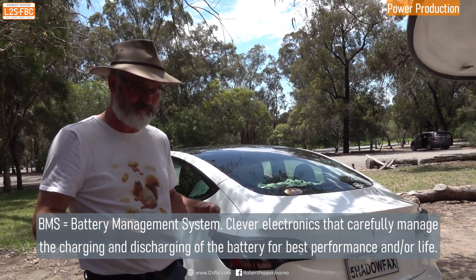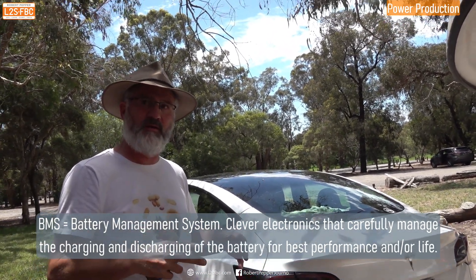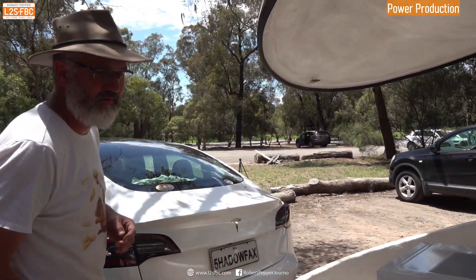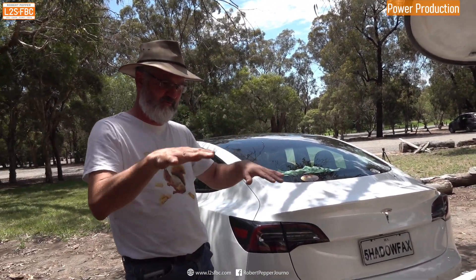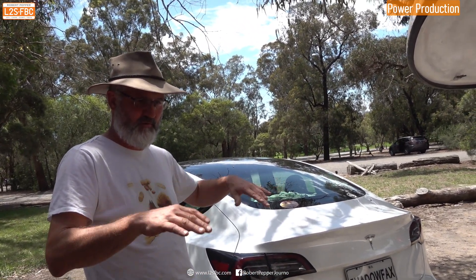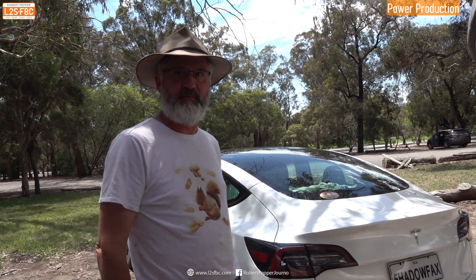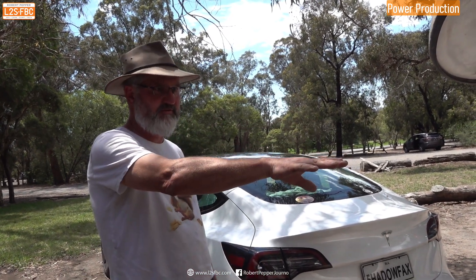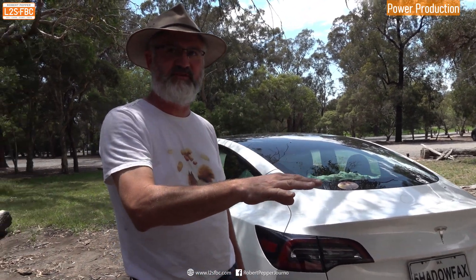The batteries are bought as cells — 310 amp-hours per cell — with a separate BMS to manage all the battery cells. A BMS is a battery management system: it regulates charging, monitors the relative levels of all the cells, balances them out, and makes sure they don't go over-voltage, under-voltage, or get too hot. That's mounted in the floor with the batteries. On top of that the Victron unit also has a bunch of those protection features and won't over-voltage things.